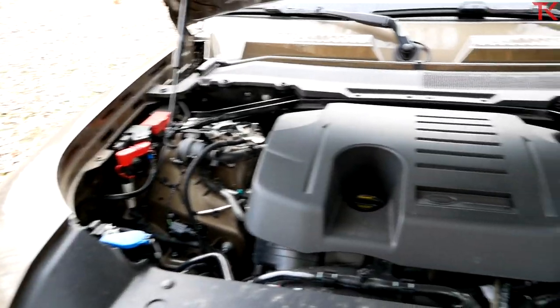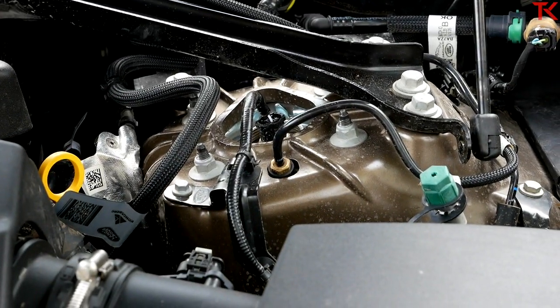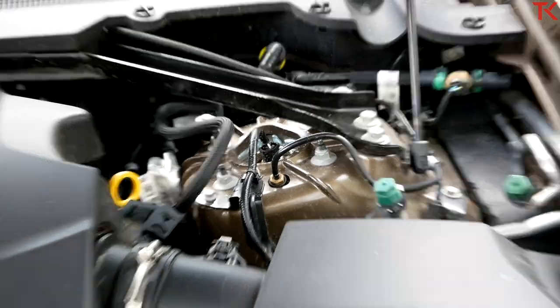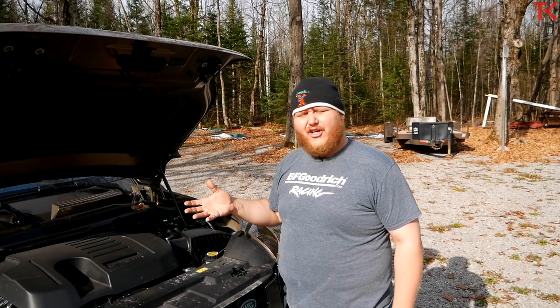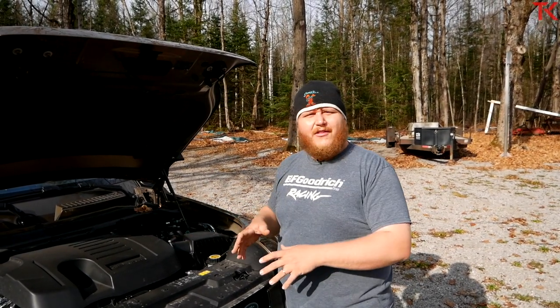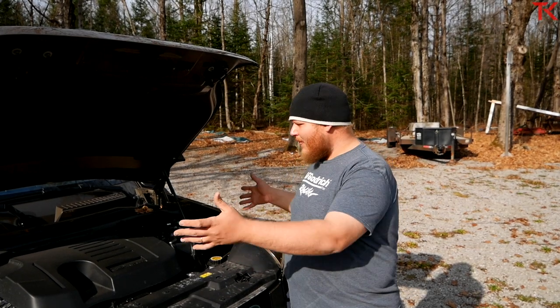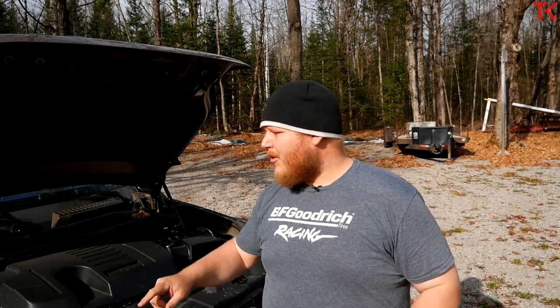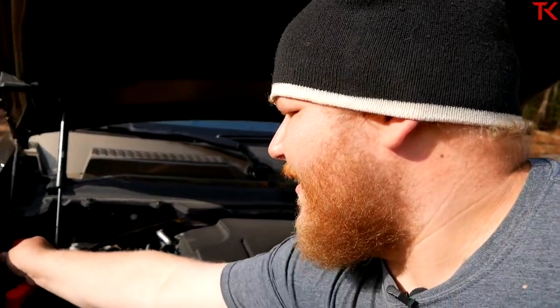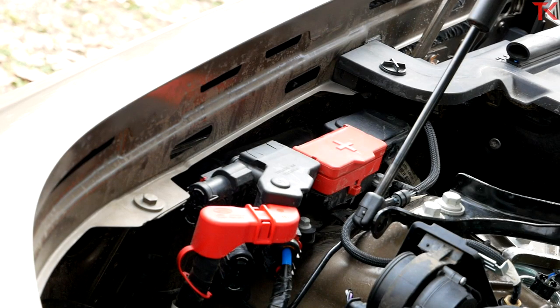First of all, what you have to notice are these shock tower mounts. The shocks come so high in this vehicle because they have those airbags, and because having your mounts up here allow the vehicle to be lifted up taller. But to accommodate for those, there's no battery underneath this hood. Right away, I'm like, well, where is the battery? Usually it's easy to get to. Land Rover does give you a workaround. They actually put positive and negative posts right up here under these little plastic covers, so you can still charge your battery, which is obviously hidden down below.